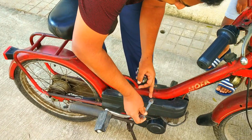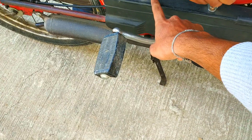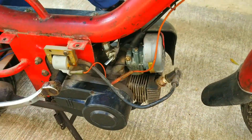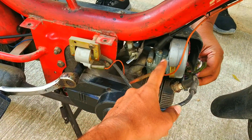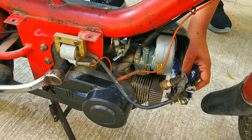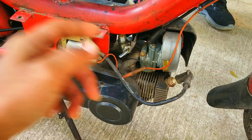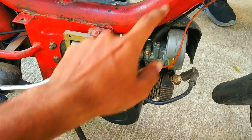Now let's open it and see the parts of the engine — all we have to do is loosen these two screws. Here you can see the coil for the ignition part, and this is the air cleaner. It's not called an air filter in those days — it uses centrifugal force technology where air is made to spin in a circular direction so that dust is thrown out.